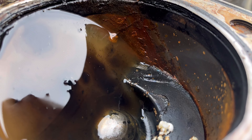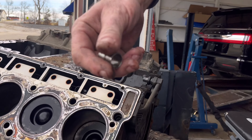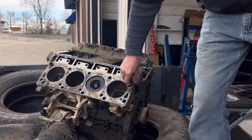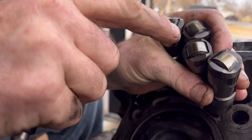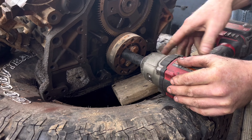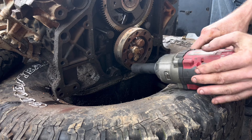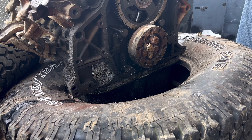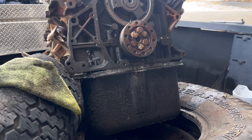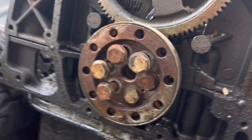The intake wasn't covered though. The cylinder walls are not very worn. Got a step dowel in it - 20 millimeter head and an 18 block. You can do that, it's not bad, I've done that before too. Pulling out the lifters - how do they look? A little bit of wear but not too bad. Let's prop this up. I can't get on it. We're taking these off - I want to take this camshaft with me.